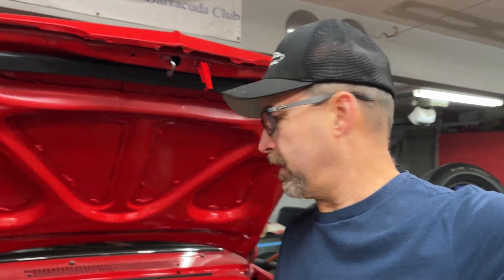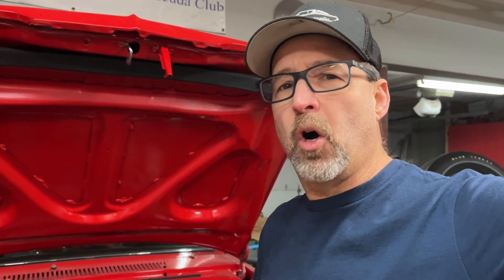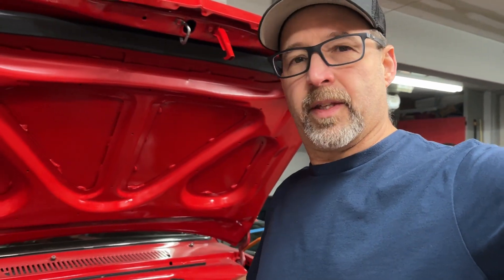One of the nice things about having a system like this is that you make note of what vehicle it came off of, and if you're ever out on the road you can go to any parts store and pick up what you need — MAP sensor, throttle position sensor, coil, ignition module — they're all stock parts. With those bolt-on units, you have to call the manufacturer and have them ship you one while you're towing the car home. At least this way you can stop in anywhere and pick up what you need. That's what I was looking at when I did this: how can I make this reliable and easy to work on and easy to find parts for? What's easier than a stock factory component?